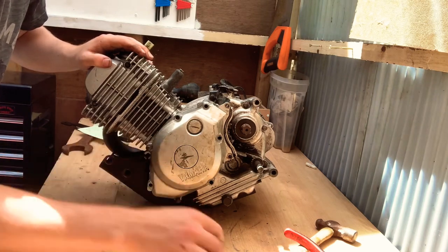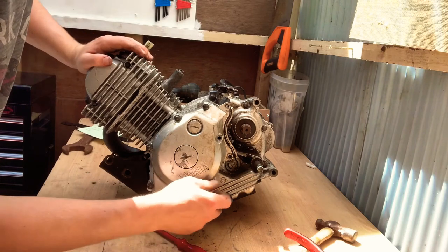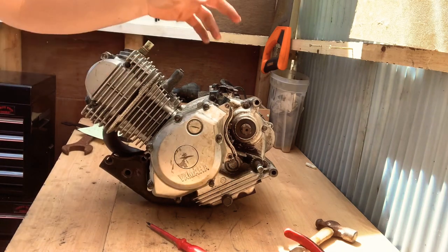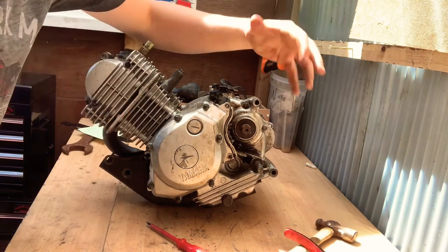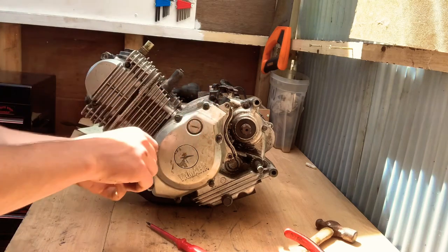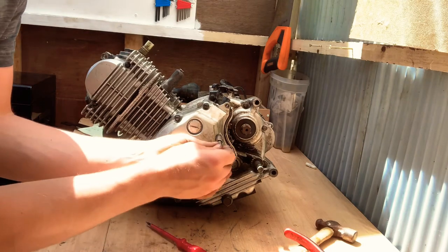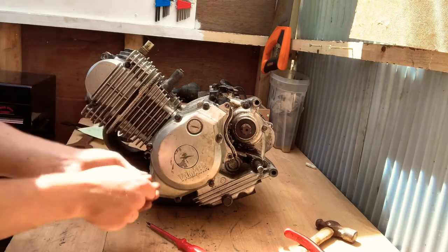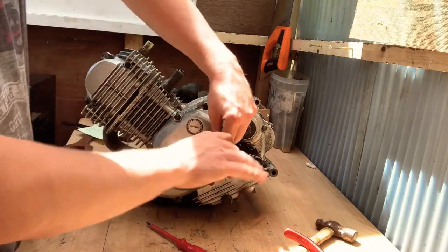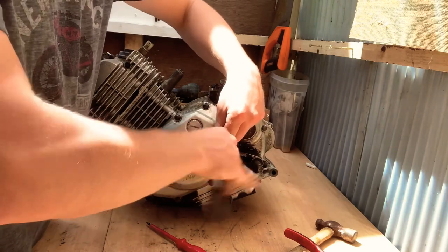Now just a heads-up — if you've watched this video all the way through to this point, you probably would have noticed I never told you to remove the sprocket cover. Yeah, I forgot about that — but there are two bolts there you have to undo for the sprocket cover. Sorry about that, should have said at the very beginning of the video. So now I'm just going to use a cross pattern for the bolts. Once they're all in you want to put your 8mm ratchet back on — this one here's got a bit of liquid gasket on it so it takes a little bit longer as it just wasn't threading by hand.